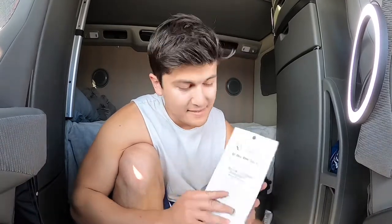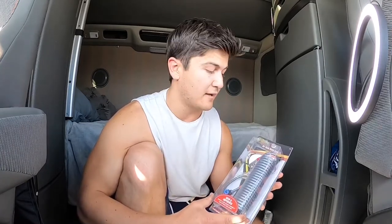Hey, what's up folks, welcome to the channel. In this video I'm quickly gonna show you how you can install your air seat blow gun kit. One thing I recommend is get it from TA, just because the part where you connect it is plastic. The ones I usually get from Pilot truck stops or Flying J, they're metal, and unless you have the proper tape or wrap to seal it, you're gonna end up losing air.